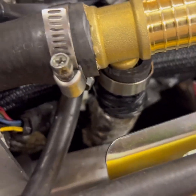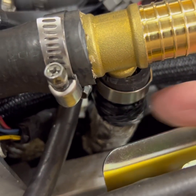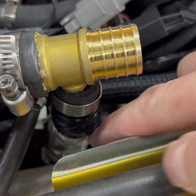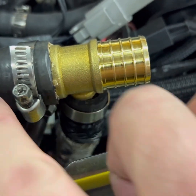I put this 90-degree fitting in here and then I'm going to come over here. This particular motor was an old turbo motor that had a turbo oil drain right here — the turbo was up front in a front-mount setup and it would drain right down into the crankcase. So I'm going to use that as another crankcase evac point, giving me two points: one baffled, one unbaffled.